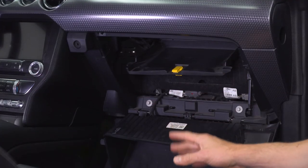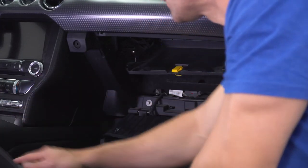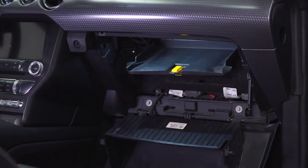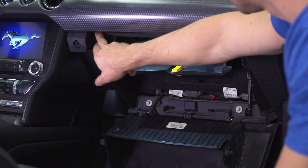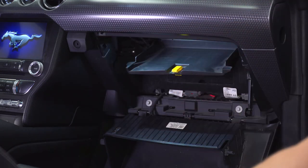Get the stock bulb out of the way, grab one of our Axials, and plug it in in reverse order. Now we're gonna reinstall our housing and harness back up into the hole, making sure we get this little spring-loaded clip to go through that hole because that's gonna turn the bulb on every time you drop your glove box. Before we button everything back up, never a bad idea to test — key on, and there you go, it's working just fine. We'll hit our switch — it shuts off, so we're good to reassemble our glove box.